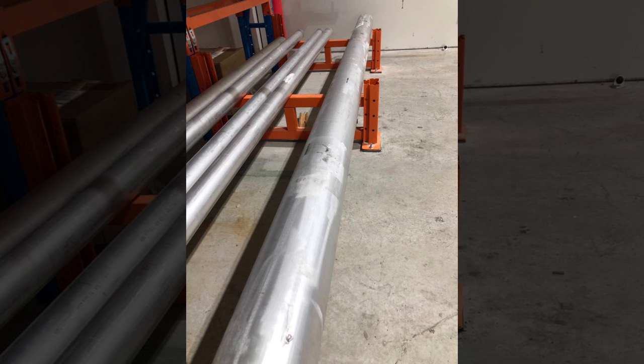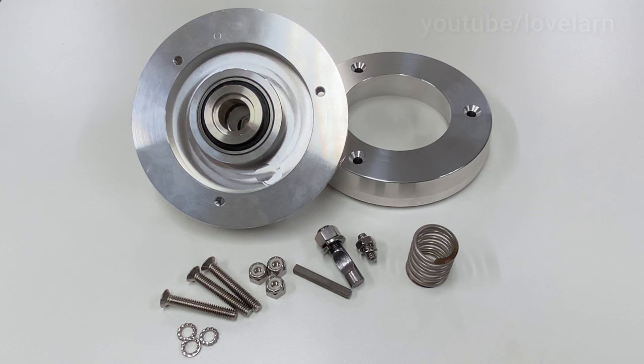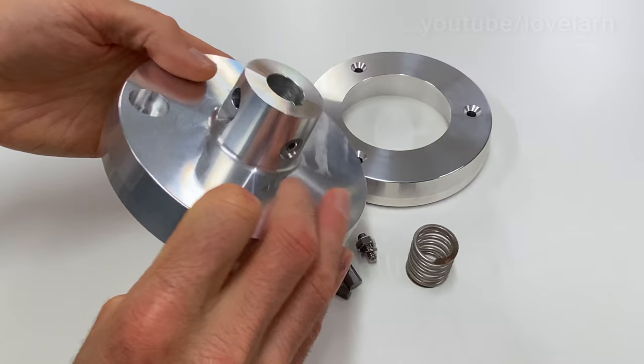Back to the billet clutch. This clutch is machined from billet aluminium — hence the name. A billet is a solid length of material that's been extruded into a cylindrical shape, and a CNC then removes material to form the various clutch components. Clutch halves were originally cast in iron or aluminium, which involves heating the metal past its melting point before pouring it into a mould. In broad terms, billet aluminium is generally stronger than cast aluminium and has greater internal consistency, which leads to increased balance. Any remaining imbalances are essentially machined out, and the CNC runs a computerized program so it's not only consistent but also ridiculously accurate. Just to look at it, this clutch is obviously a well-made quality component.